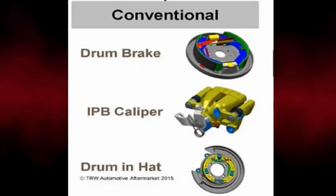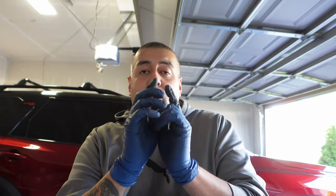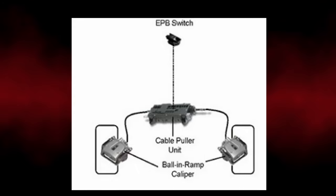When you use the parking brake as you should, you're using those rear pads. On a traditional parking brake — the cable-driven lever or the step-on pedal type — that cable pulls a small tensioner inside the drum housing. There are shoes inside that drum even though you have disc brakes in the back. When that cable is pulled, it releases the tension, letting the shoes expand and hold the brake. My 2016 Escalade has an electric motor that does the same thing via a pulley pulling the cable, still using shoes in a drum.